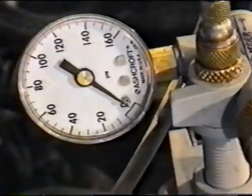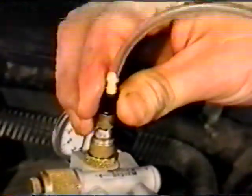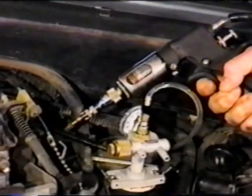Once a seal has been established, push the slide valve to the left in the system position. The bladder will remain inflated and the gauge will read system pressure. Disconnect the injector from the system inlet. Using a luer connector, attach the injector to the reservoir fluid inlet as shown. Attach the capture container to the first wheel in the bleed sequence, making sure to use the one-way check valve. Open the bleeder valve. Using slow, steady strokes, apply pressure to the system. Repeat this process at each of the wheels in the sequence until all air has been removed.